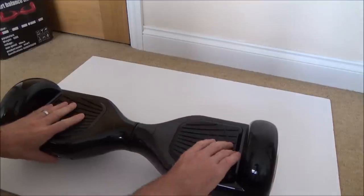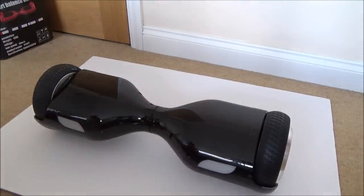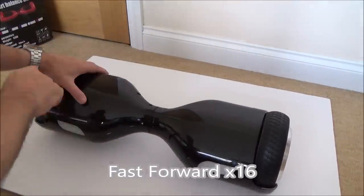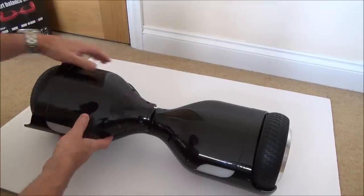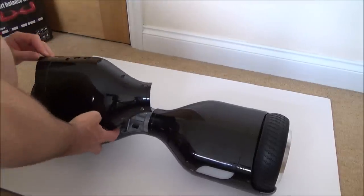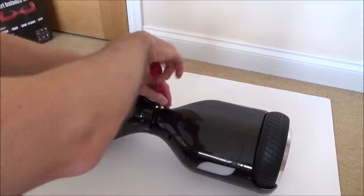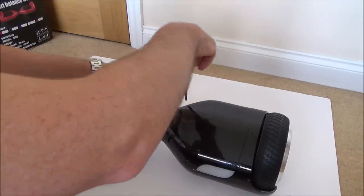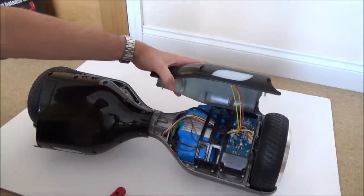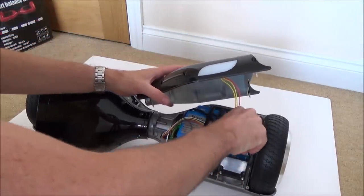There's just a load of screws underneath it. I don't actually know which side is faulty because it's a red light and neither side is working. I sort of thought it might be just one side. So I'm going to undo all these screws — there are quite a few around the place. There's going to be a wire connecting up the lights, and actually there are quite a few wires on this one. I'm going to leave that loose for the time being, because it's not just the lights — there's also the on/off switch and the charge socket at the back. There's a little connector here to undo the light, so I'm going to pull that one out.